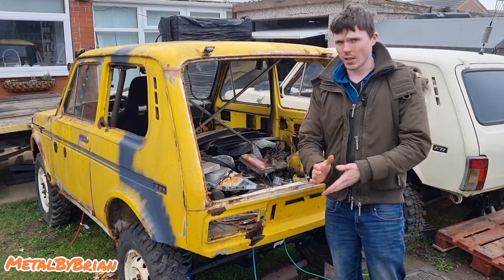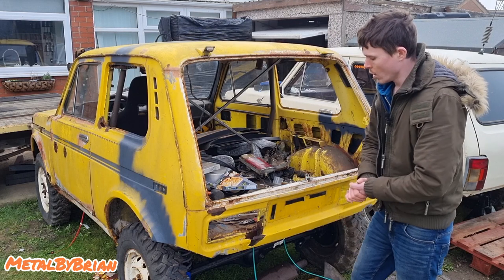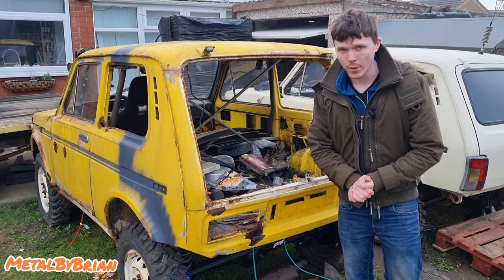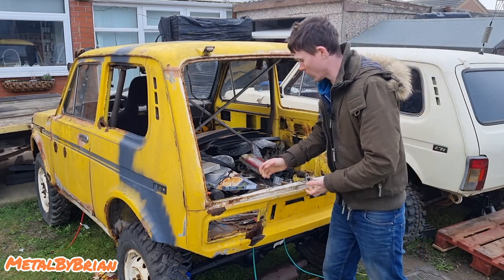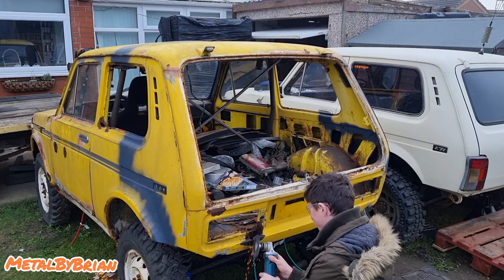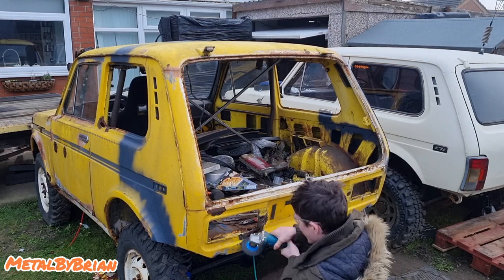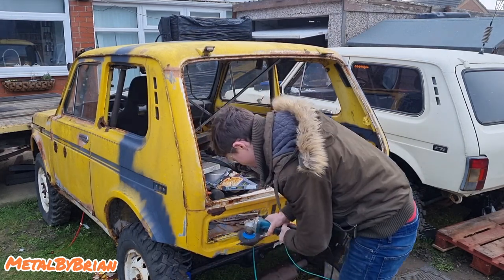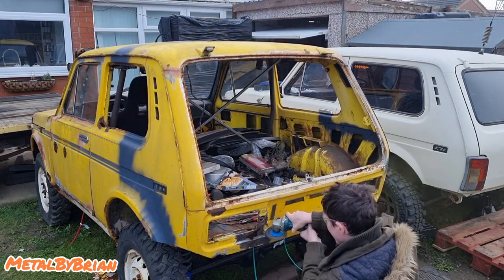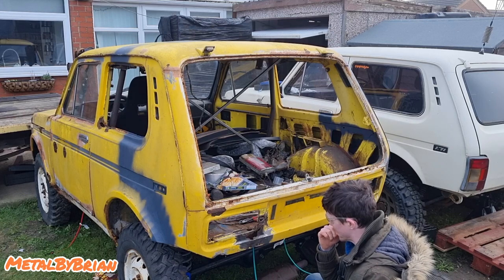So first of all, like I said in the previous video on this series, whenever you start working on rot, the first thing you should do is attack it and really take your anger out on it, and get a wire wheel on it with a grinder and rip into it. So let's crack on and do that. Right, I'm going to do the rest of it as well whilst I've got the grinder out. I might as well, for the sake of it.